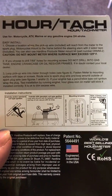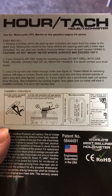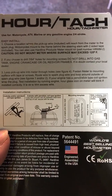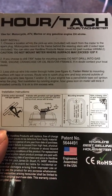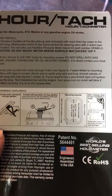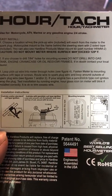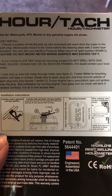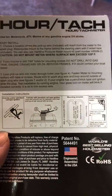I was told by a certified Honda tech: don't take your RPMs over 3,350. He said above that level you can do damage to the valves and all kinds of other things — you can overheat it because it'll start running too lean. All kinds of problems. Anyway, let's go outside.